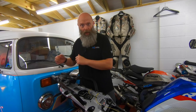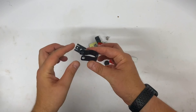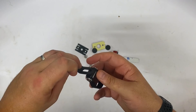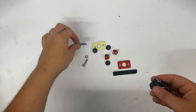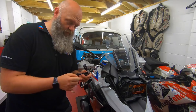Now it's a question of locating the cameras. The kit includes all standard fixings for the usual mounting scenarios. The camera itself is held by a U-clip with a base section bolted together using the shorter screws. You can then use either the L-bracket or a base plate, screwed on using the middle-length screw. Use the 3M-backed rubber strip on the inside of the U-clip to stop the camera rotating. An alternative mounting solution — the one I end up using for the front — is to use one of the base plates with the 3M adhesive strip.